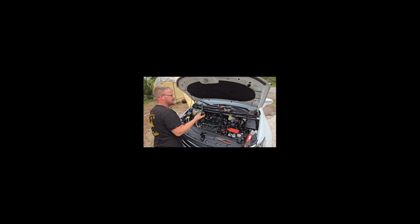Cylinder 1 covered in oil, just the way cylinder 5 was. Alright, those are some extremely small holes. You can see in 3, I can't see in the other 3, but I'll grab a borescope and see what I come up with.